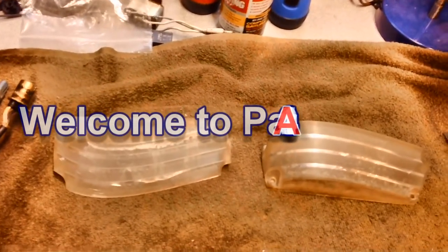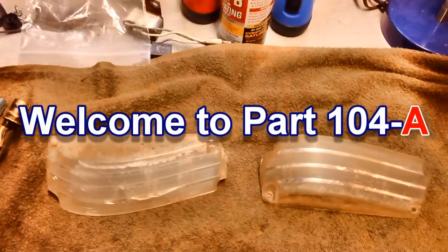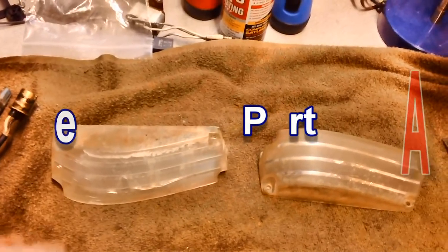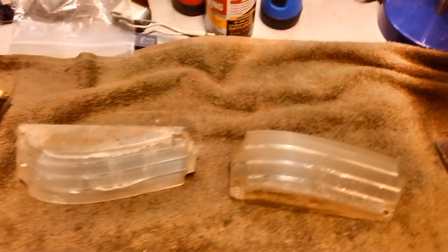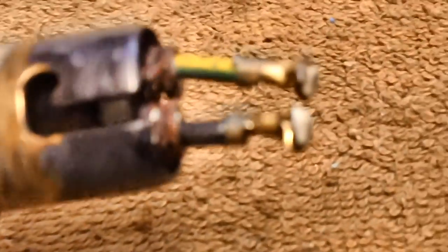Well, hello again. Today is the 12th of December. By the 22nd, which is 10 days from now, I want to have the car ready to go on its test drive and get this video uploaded on the same day so you all can see how it went. And I've ripped out the front parking lights, not essential to the test drive, but I wanted to take a look at them and see if I could repair them. Actually they're in pretty rough shape, just like the rear. These take 1157 bulbs also, and you can see the springs are so rusty that they won't even go up and down in there.